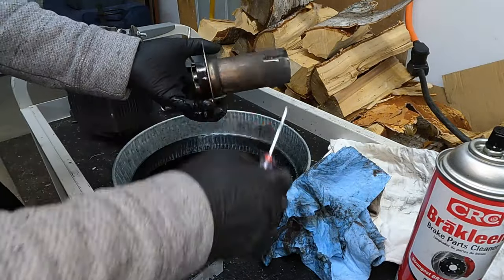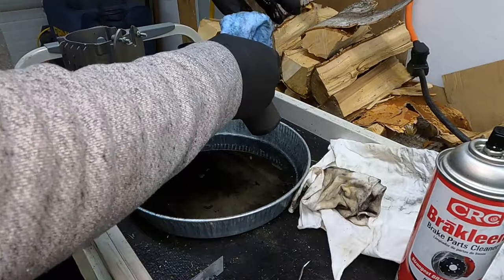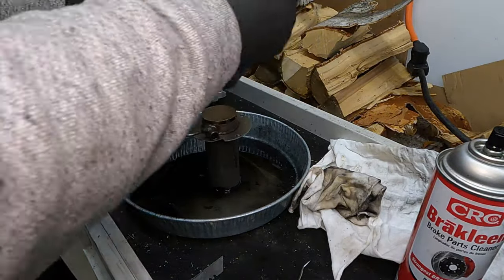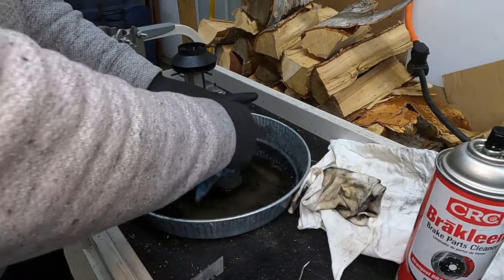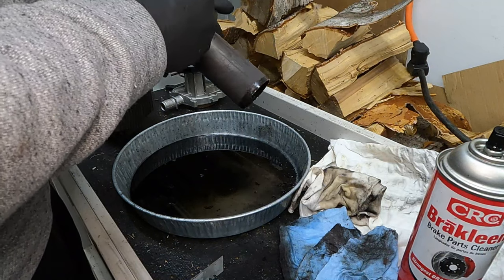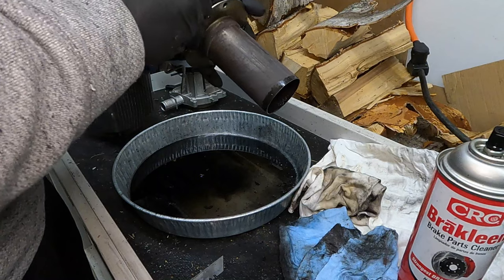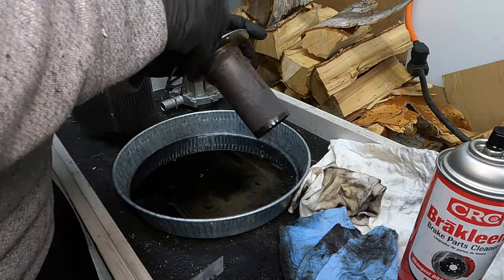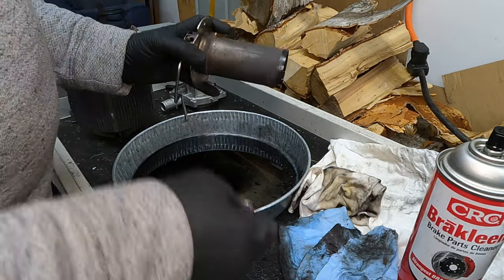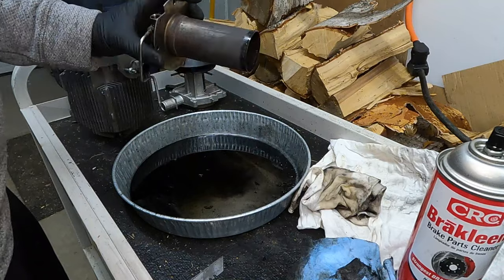I'm going back after this screen on the fuel intake to see if I can get it out. I got the little air orifice cleaned, so that's okay, but I want to make sure the screen itself isn't full of junk blocking the flow of air. Some of the problems I'm having are absolutely 100% my own fault. I experimented with using vegetable oil to fire this thing, and that really was the thing that I think triggered all these problems. I mixed it in with the diesel, but evidently it just will not burn adequately in this system. So I won't be doing that again, and I would definitely suggest anybody else who has these not try vegetable oil.